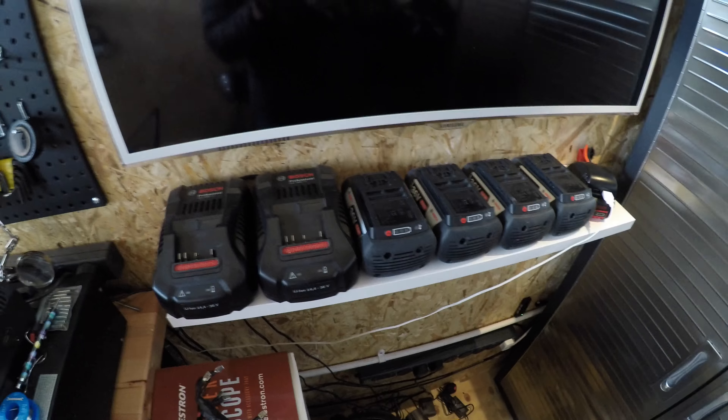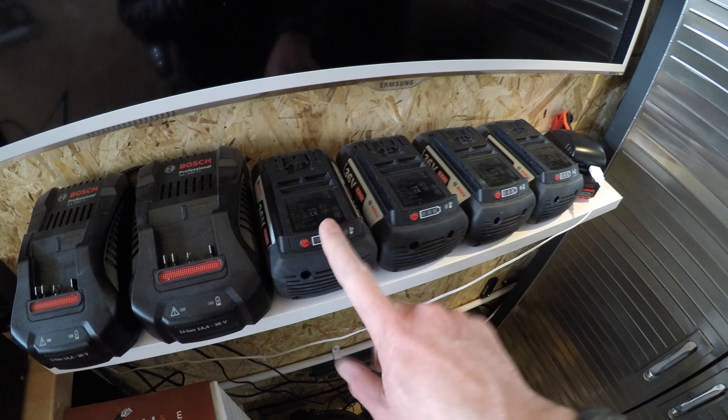Quick update on what's happening with the bike: my battery is still away getting sorted out because there was a series of cells that was a little bit iffy in the pack. Something went wrong and one bank just completely discharged, so it was effectively like a 19S pack. I didn't bother trying to fix it myself — Insats supplied the battery so it went back to them, they've sorted everything out, and it's going to be winging its way back to me this week.